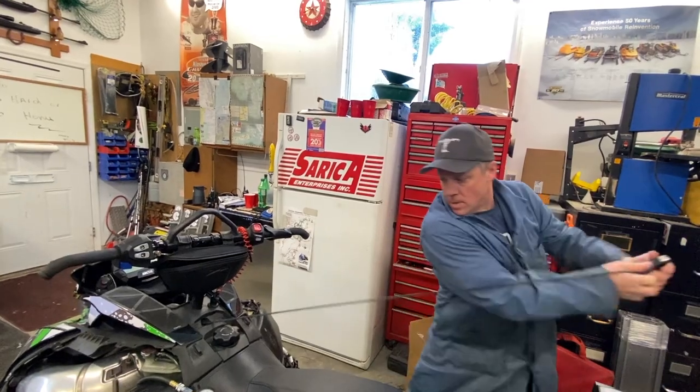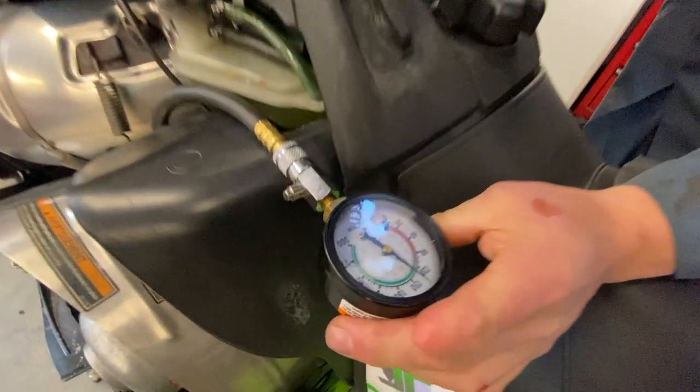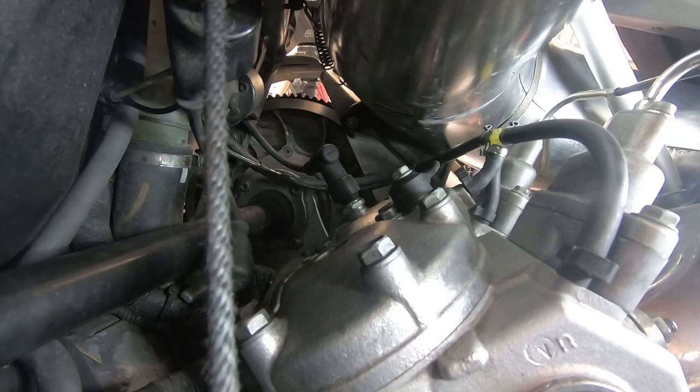Today I'm gonna do a quick compression test on the cat. I had a few guys on our channel ask about compression tests and what's right, what's wrong. I do it the same way all the time so that I get the same results. Today I'm gonna do two different ways just so you can see if there's a difference. The motor is cold, so you're gonna get a little higher compression — not much, because the oil on the cylinders is a little colder, maybe a couple pounds. It's very hard to do a hot test on these motors because of where the pipe is by the spark plugs — you're always burning your hands and stuff like that. So I'm gonna do a couple quick ones for you so you can see the difference.